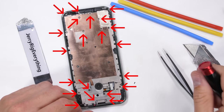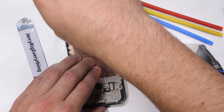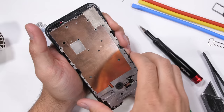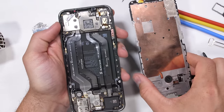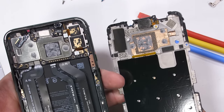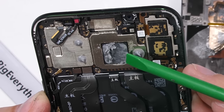There are 21 Phillips head screws holding the mid plate to the rear body. Other phones we've seen with a mid plate like this, like on the Nokias or the HTC 10, are super incredibly rigid, which explains why the Black Shark 2 performed so well in my durability test. Finally shimmying out that massive mid plate full of copper, we see why Black Shark calls this direct touch. Most smartphones don't have their processors exposed, but here the main Qualcomm 855 processor has the thermal paste directly applied to the top, which rests right up against the copper metal heatsink, exactly like we see on computers.